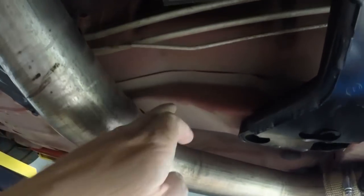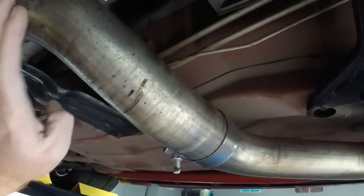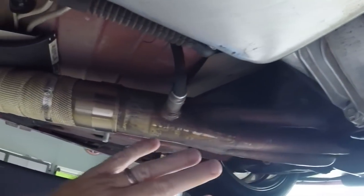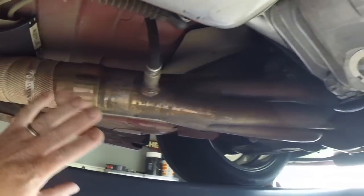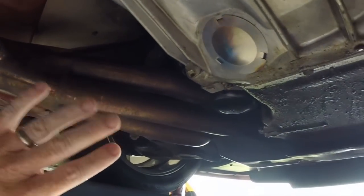The other thing is, if you notice, the Y-pipe needs to come up further, and this is as far as it goes. So this is a Texas Speed Y-pipe. Not real sure on the brand of headers. They are stainless, but I'm gonna be getting rid of all of this and going with that Speed Engineering. Now these are 1¾" primary and 3-inch Y-pipe. The ones that I purchased are 1 7/8", so it is gonna be a little bigger, and there might require some other things up top,